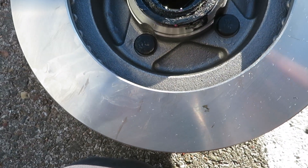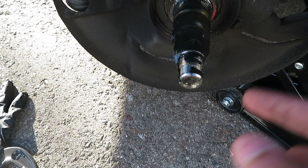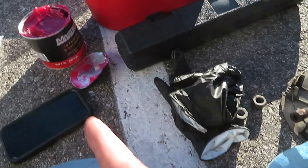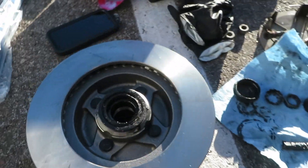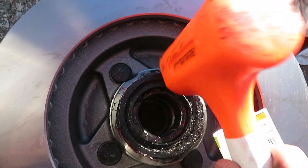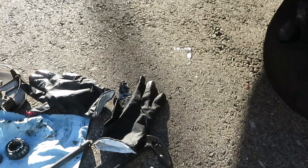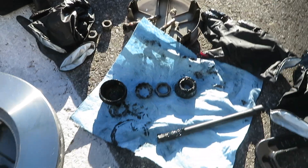Honestly, this had so much grease on it I'm going to go ahead and reuse it. I'm not adding any new grease to this one — especially the inside of the spindle — just because there's so much and it's really good. On the other hand, I'm gonna wipe that off and put fresh grease on. I also want to check the bearings to make sure everything's good, which it does look fine. I'm gonna get this all packed in the grease as well, then put everything back on. Using a little hammer, push this down in — nice and smooth — and it's all the way in. Then slide it back on and clean up the slide buildup.